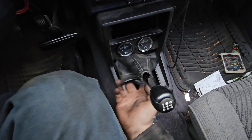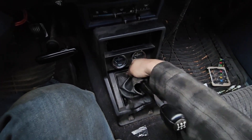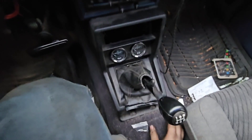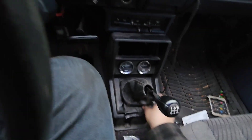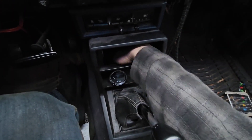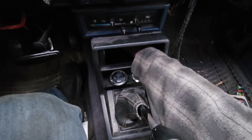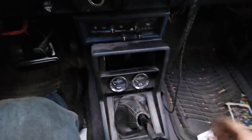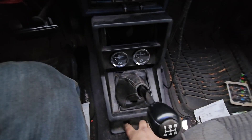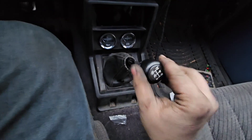These are actually simple when your boot isn't completely right. So on these ones, you pull the shifter bezel, and there's a main harness connector for these gauges right here. Push them together and pull. There are two connectors here, and then there's a bracket inside with a screw on each side. Then the shifter thing will come off and you just turn the shift knob.